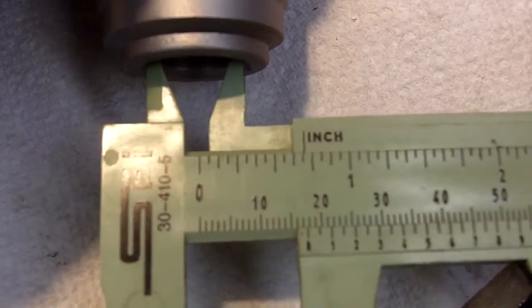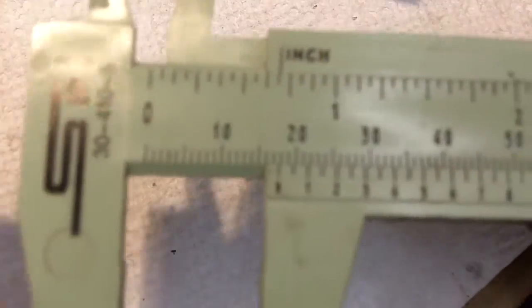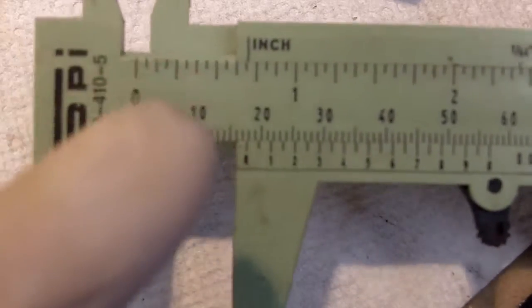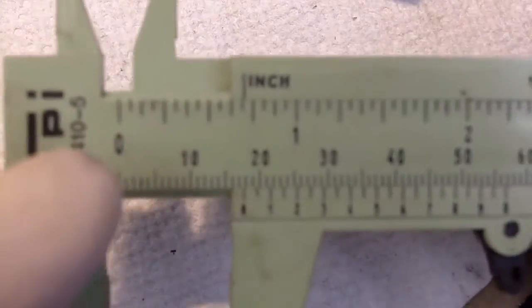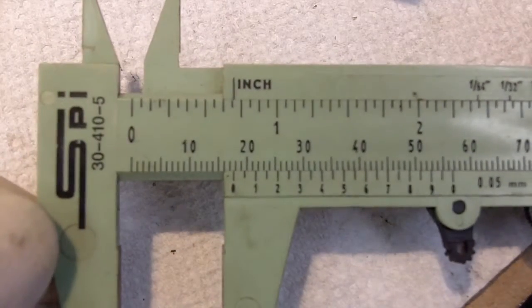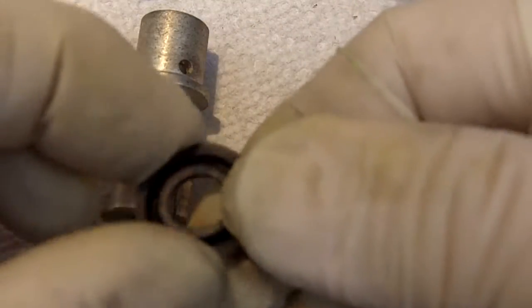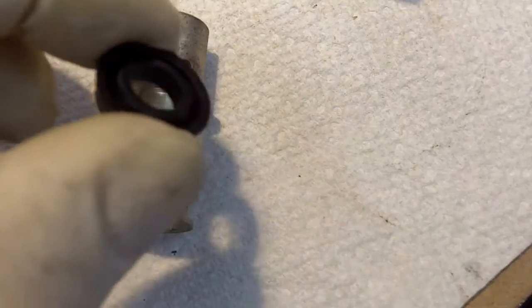It won't go unless you push it in there, and you can see it's just a smidge above 11/16". So that's the amount of drag you need on those lips. That's measuring an original cup. Now we're going to take the one that I supply in my kit.